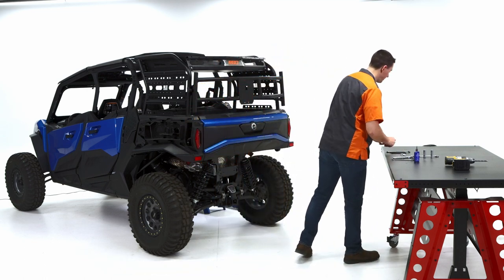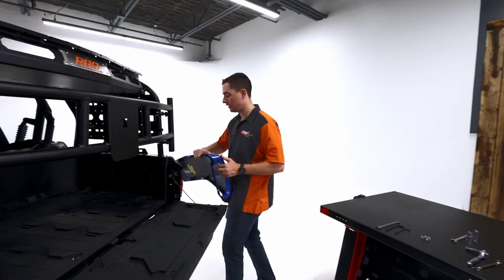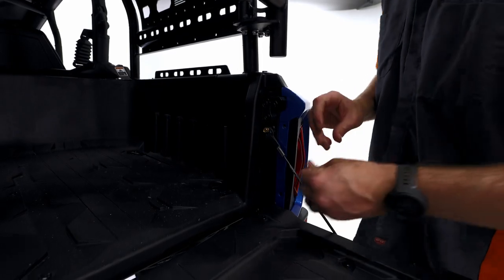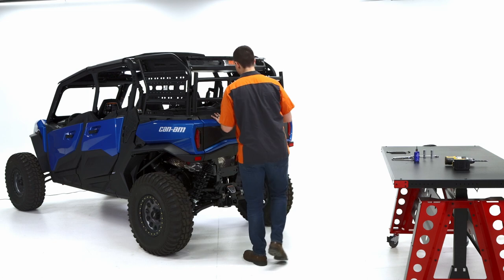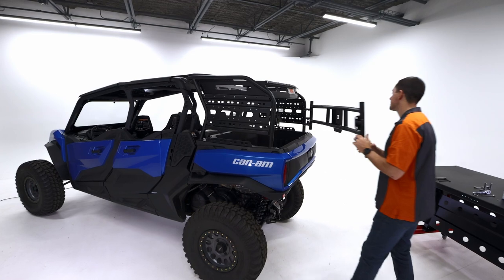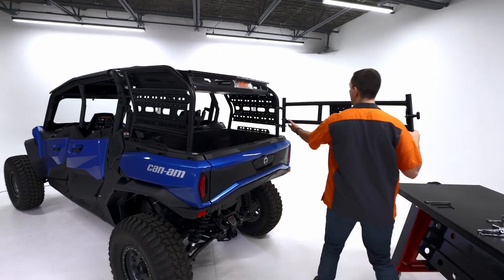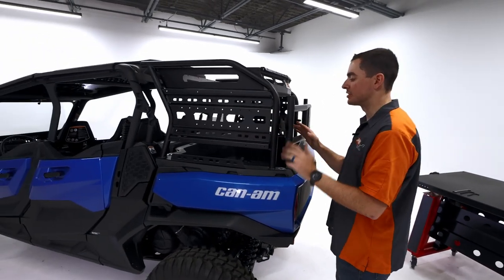So lastly, we're gonna put those panels back on. I'm gonna go ahead and grab those. That tailgate, that's gonna wrap up the install, but just to do a double check over everything, we're gonna make sure that this tailgate opens smoothly and that latch closes when it's open. It shouldn't go anywhere when it's open like that. Pull that pin up, should fall back, and it latches well.